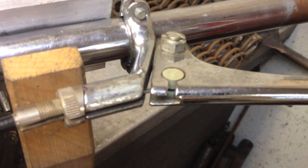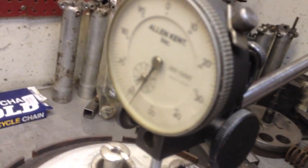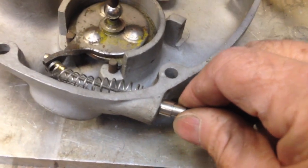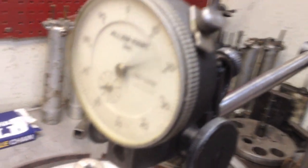Now suppose here at the lever I'm beginning to get a little pressure — just a little bit. Let's loosen this a half turn, full turn, so now I have a little bit more play. How does that stack up over here? Now I've lost about five thousandths of an inch of travel. If I have an inline adjuster and screw that in a little bit so I have a little play in the cable — how does that impact my lift? Now I'm down to half of what I had before, simply because I have just a little bit of play in a couple of different places.